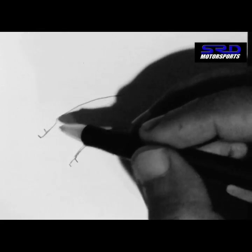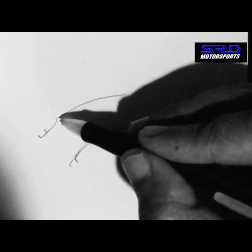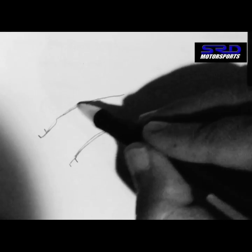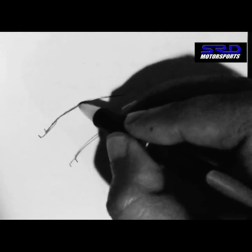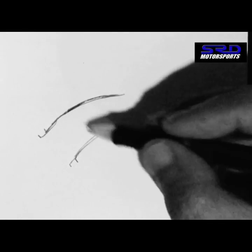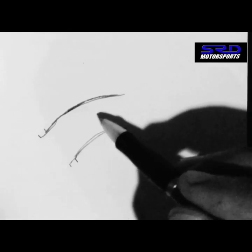We're going to try to smooth it out here now. Imagine if we grind this off just to make it all look smooth — visually it'll look like, wow, it's a ported head. But notice now the cross-section has been significantly enlarged. That would mean you lose a lot of airspeed, and in turn, that's lost torque.